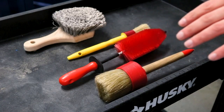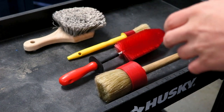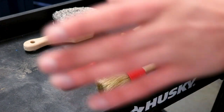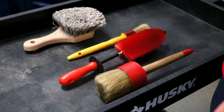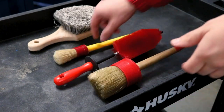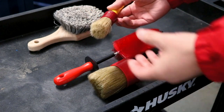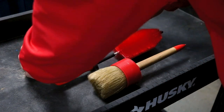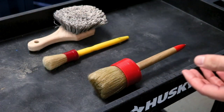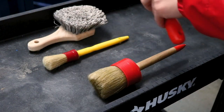These are the four brushes that we're going to use — they're all from Chemical Guys and they're all great for engine bay detailing. This first one is super soft — I think it's typically a wheel brush — but we're going to use it around the sides where there's painted areas and on the inside of the bottom of the hood, because that's also painted, so these soft bristles will work perfectly. This is going to be your boar's hair brush, which I'm personally going to use to agitate the product into 95% of the engine bay. Your classic wheel brush is good for getting into wheel barrels — in this case we're going to be able to reach down into the engine parts where it's tighter and the larger brush isn't going to be able to touch.